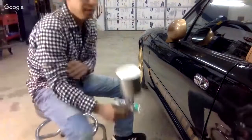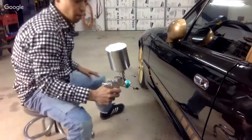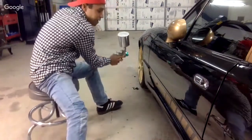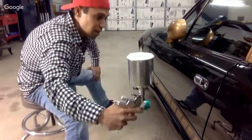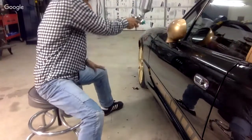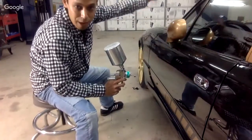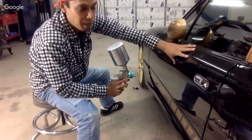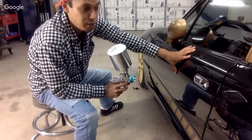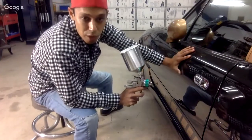When we're doing metallic painting, you can paint like this — go over your panels, do your base. You can go around the car two times like that if you're doing a complete paint job. And on your last coat, what I like to do is dust it. Up the pressure one to two PSI — that's the trick.